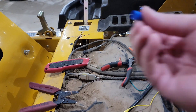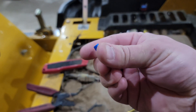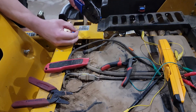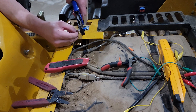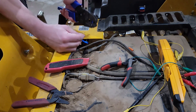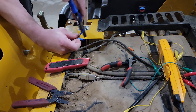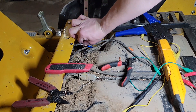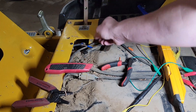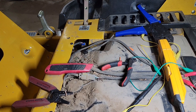With my little terminal kit I found that these blue female spades will fit perfectly. When plugging these terminals back up, it doesn't matter which terminal they actually go on — the whole point is just to get continuity. That worked out well; I didn't have to extend the wires at all.